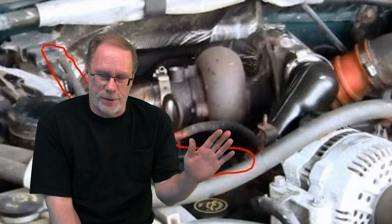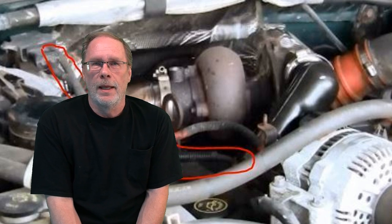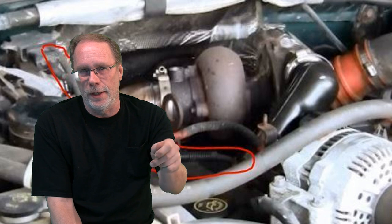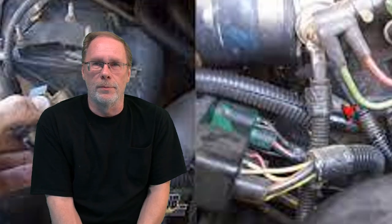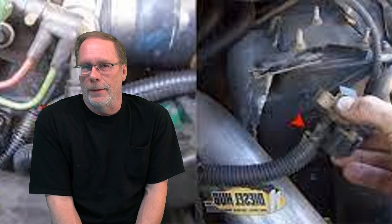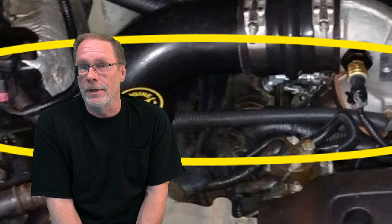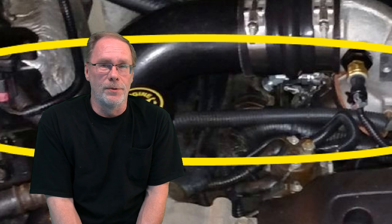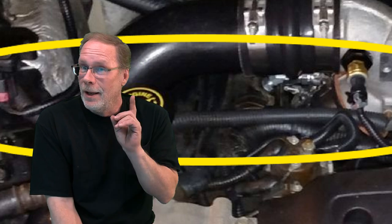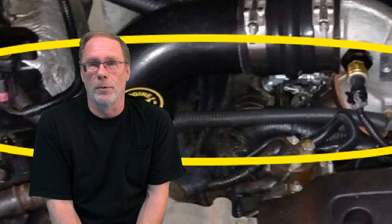First, let's do the obvious. Let's check the rubber tube. Now, let's face it, these trucks have got some age. If you can, at the sensor or at the manifold, take that rubber tube and turn it easily, you need to get that rubber tube off of there and just replace it. It's probably already got cracks in it, might have a hole in it already. The clamps could be worn. Either way, that rubber tube is spent because of the years. Do yourself a favor, it's cheap. It's one of the cheapest things you can do to better your fuel mileage and not have runability problems. Just put a new tube on it, get her done. Don't forget to put the loom over the top of it, that way, if it's brushing around on top of anything on the motor, it doesn't rub a hole through it.